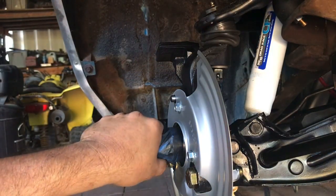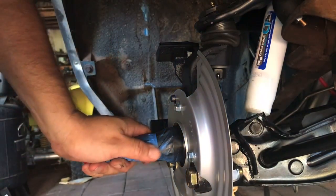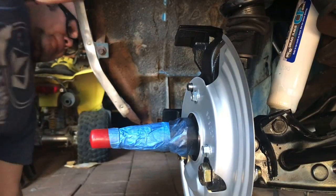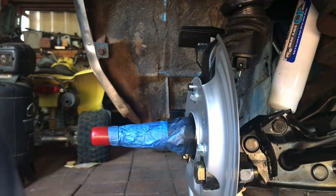As you can see, this spindle is basically turned in, so we're at toe-in right now. I still have the tie rods loose, and all you have to do is rotate the sleeve to either pull it in or push it out. I'm not sure which way is doing what yet. When I first put the tie rods into the sleeve, I basically threaded them in about halfway, which gave us a very toed-in position.